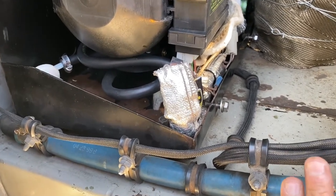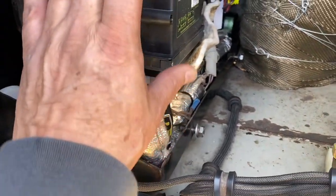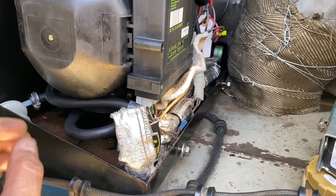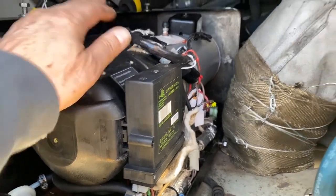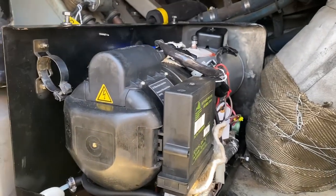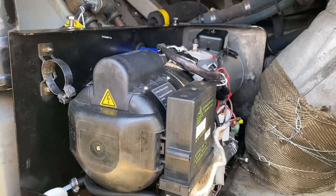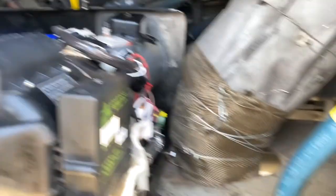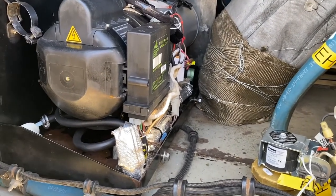Fill the tank up all the way to the top to get a lot of static head pressure. I use the test box in place of the control box, start running the coolant pump, turn the engine on, turn the driver heat on, and start the whole bleeding process — with the Webasto off, just the coolant pump running. I'm just trying to get coolant coming through the pump up into the front. It takes a good hour, almost two, to get the system fully bled. I replaced this valve here — it was clamping off these lines — and I put a new chip in that valve as well, so I lost about five gallons of coolant out of the system. Lessons learned, and I hope telling you a little bit about the system helps.